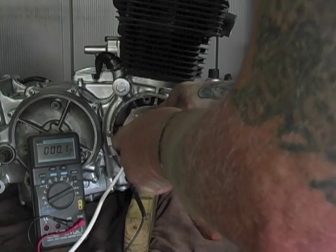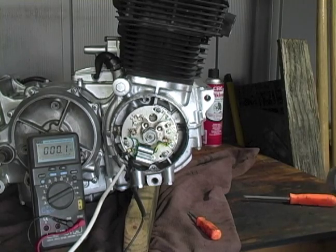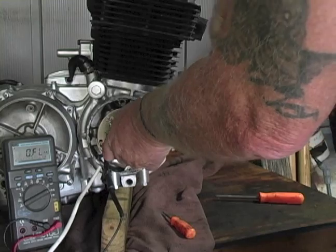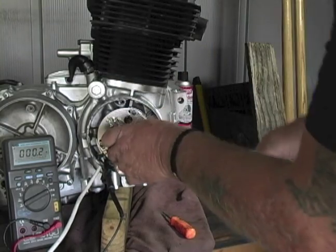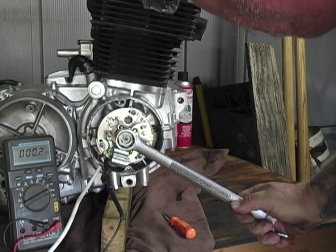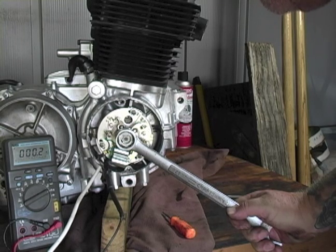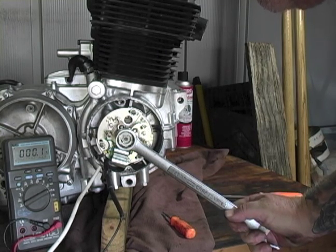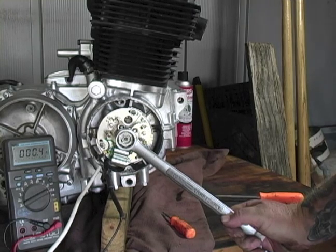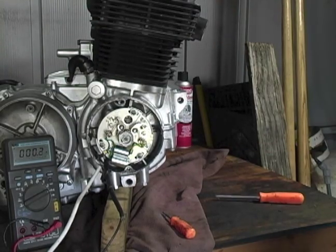You can see the meter going both ways here — that's good, because we're looking at just when that contact separates. Now with everything snugged down, we're going to go ahead and spin it around again. Looking through the window for the 1-4 marks, bring it up just to the F, but now I'm going to watch the gauge more. Just barely moving it, slowly. There, we're starting to make a change — a little bit too far, so we're going to work with that a little bit until we get it right where we want it.